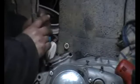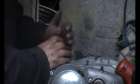Here you can see me trying to distinguish which is the front. Usually on original pistons they're marked with an arrow, but this is a +40. Lucky enough it had an arrow, but they don't always. So keep it in mind, especially on a two-stroke where it's important that the ring pegs are in the right position for the bore, not to interfere with the transfer ports or the exhaust port.